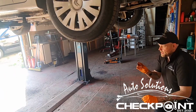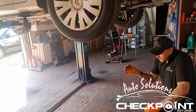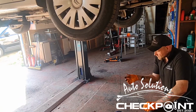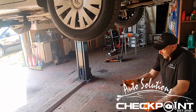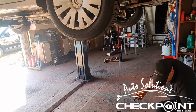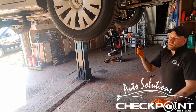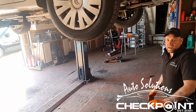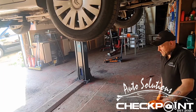Also, with another wee tip, you want to be checking the condition of the oil, and feel if there's any grit or anything in it. Like this. There's already oil at the bottom of this anyway, but that is quite decent oil. It's in decent condition. I would say you would get longer out of this, but these vans get serviced every 8,000 miles, so they're always kept at their peak. It just keeps them reliable for the road.